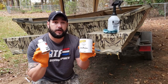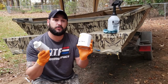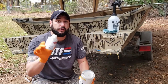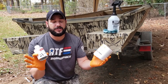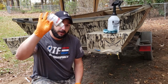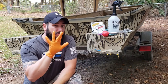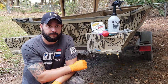For clear coat we're going to be using One Hit Wonder flat clear coat system. This is a two-part system — the mix ratio is four to one: four parts clear and one part hardener. There are tons of videos on how to do the ratios properly, but my PPS system has the ratios on the side of it, so I just pull four parts of the clear in there and one part hardener and it's good to go. Also make sure you're wearing gloves during this entire final process — you don't want to leave oily fingerprints all over something we've spent way too much time on.